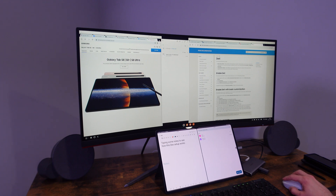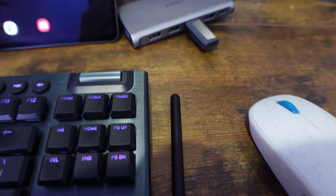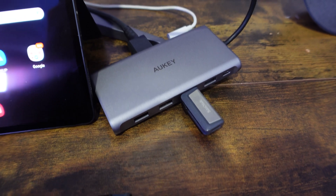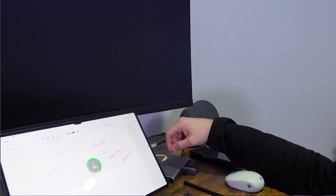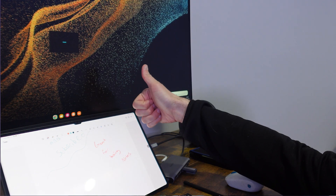What is powering all this connection together is a USB-C hub from AOC. Make sure on any of your USB-C hubs that it's getting power — either power pass-through from the monitor or another USB-C plug-in to the hub. You need power for HDMI for it to pass enough of the signal through from the tablet to the monitor.